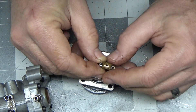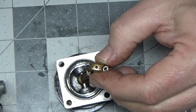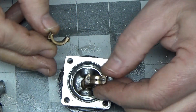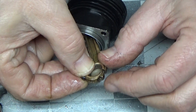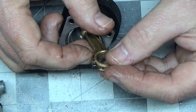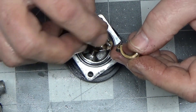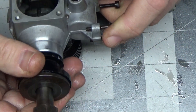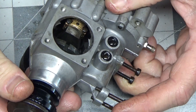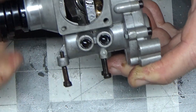What looks like happened is a catastrophic failure of the screws on the end of the connecting rod. I'm not sure which came first — whether the head sheared off this screw first, or if this other screw sheared right there. The head is missing from one screw and the other screw is sheared in half, with half of it still in the bottom of the connecting rod. Either way, the connecting rod was the source of failure. The other connecting rod is still in place and I don't feel any bearing issues at all.